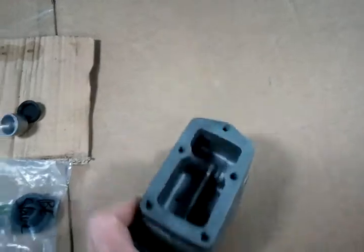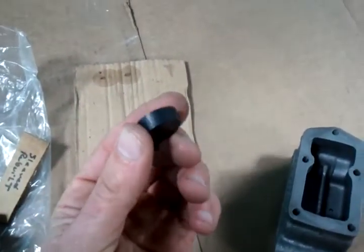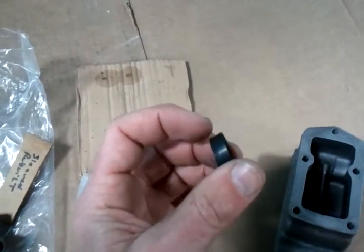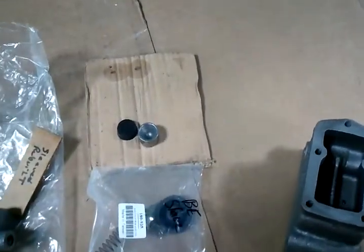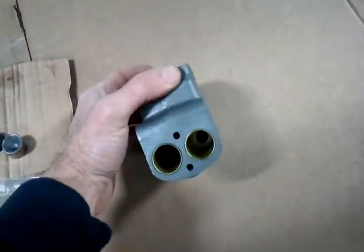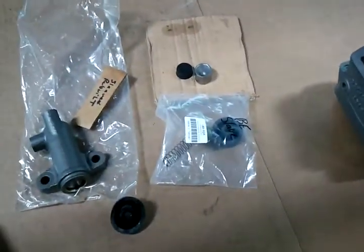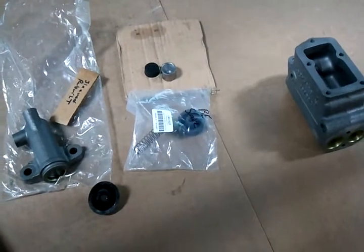And what that does is it allows this little all-important 99-cent part to slide on those bores without getting chewed up on the edge. And as a result, you minimize your likelihood of leakages. So that's how we address this with this uprated slave cylinder, this uprated master cylinder. We rebuild them, we put them in the cars that we sell, and it's one more way we try to make these cars more reliable here at BugEyeGuy.com.